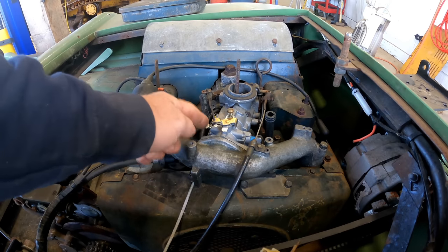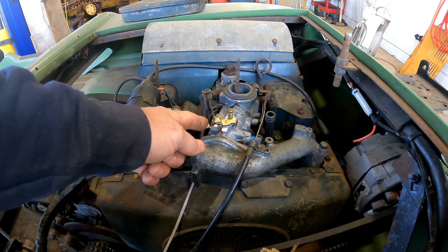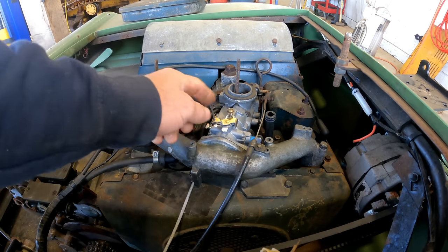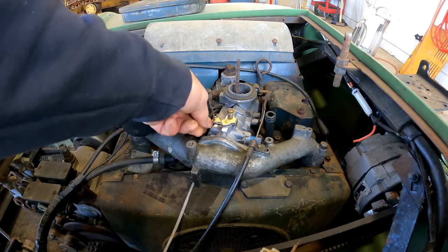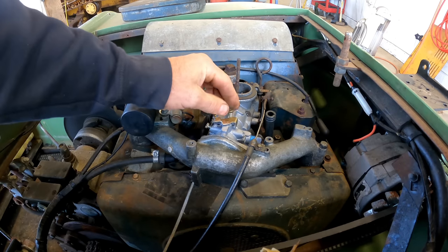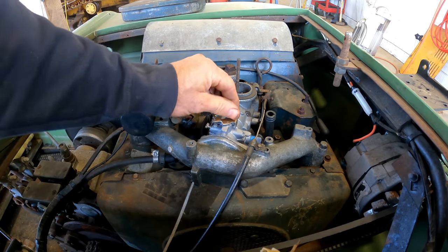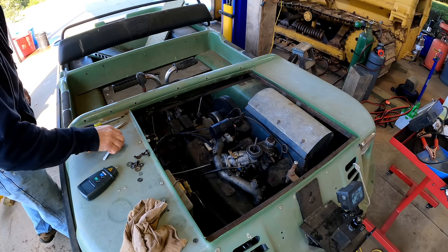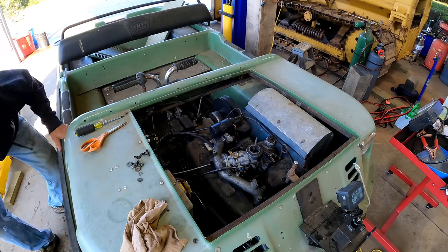Oh, the other thing, I looked up and I found that the pilot screw is supposed to be a turn and a quarter out, and the main jet is supposed to be 2.5 out. So I am not on the right numbers there. Half, one, and a quarter. Half, one, 1.5, two, 2.5. That's where it's supposed to be, according to the manual. So let's get this thing started, and we're gonna check the RPM and see if this governor's working. Now, after sitting overnight, is this battery gonna start again? That'll be kind of interesting to see.